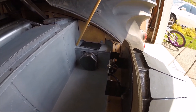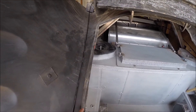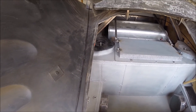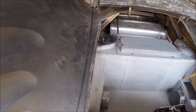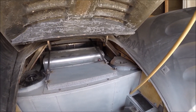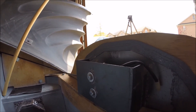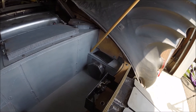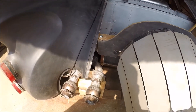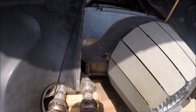So that is the trunk finally working! Next up, we'll be putting weather seal down along here — I'll probably need to make a little U-trough coming all the way down the side with some rubber seal on it, which will again be a pain but will be finished work. Now I have the good mechanical parts of the trunk working. I had welded in these braces at the top instead of just bolting them to the body. I also have notches on the striker mount so I can move the striker up and down to adjust it. Next I've got to figure out how to attach the exhaust tips onto the back and maybe make some jack points. That's it for the trunk — thanks for watching!